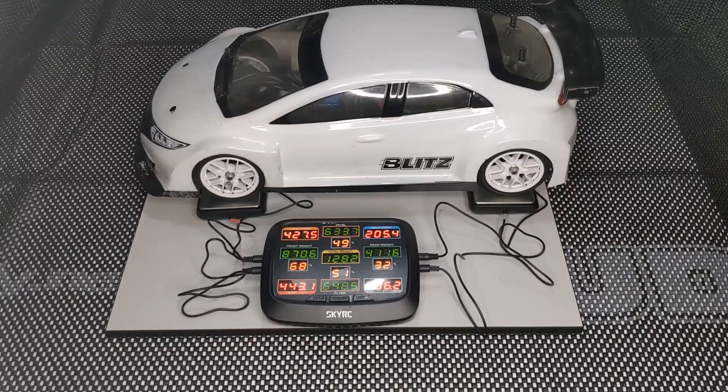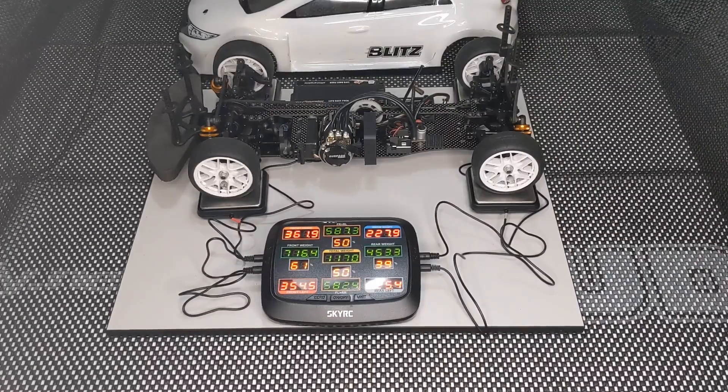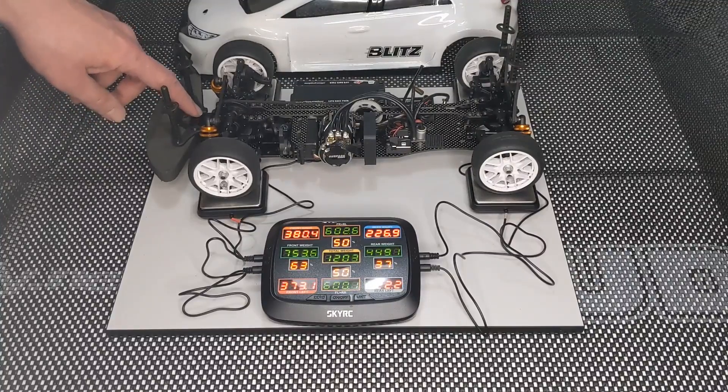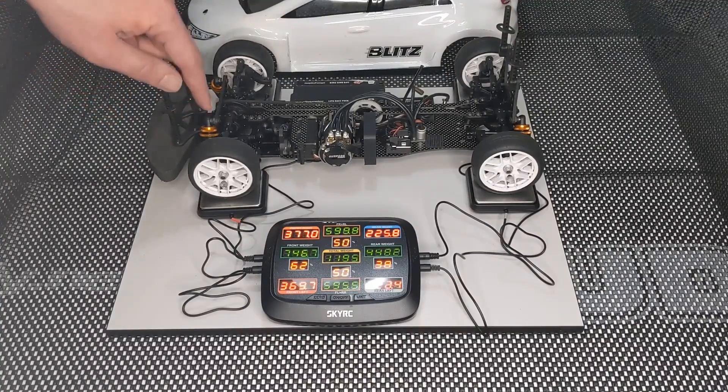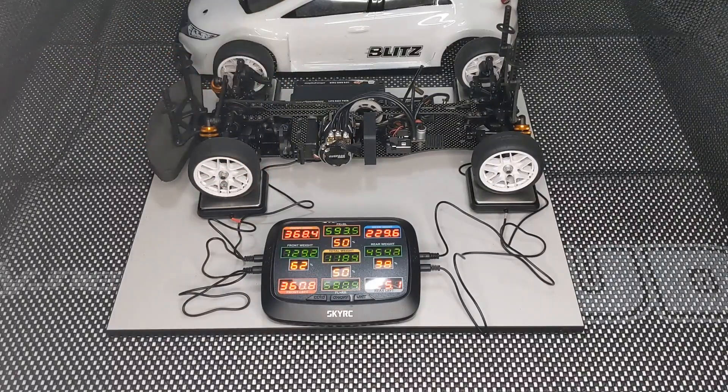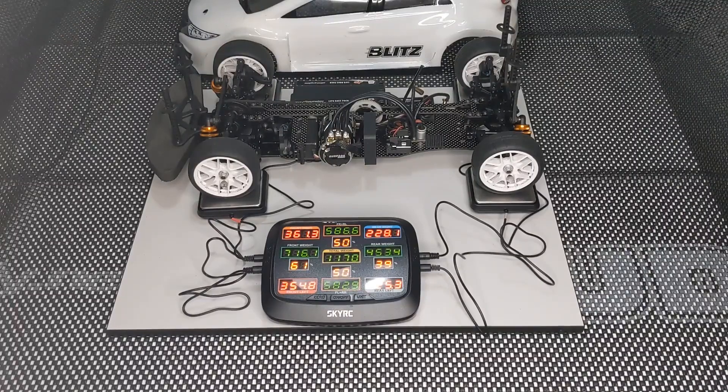So what I'm going to do now is compare this to the 21 car and see what that has with its standard mid-motor configuration. Now we'll do the same with the 2021 car. I've got it on the scales without the body shell on just to point out where I've got some ballast already. There's 10 grams extra directly on top of the standard bumper weight, around about 20 grams in front of the servo, and also 20 or 25 grams in front of the battery on this side. I won't go into the corner weighting now — I can do that in another video if people are interested. Do leave a message in the comments if you'd like to see a longer video on corner weighting.